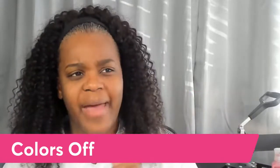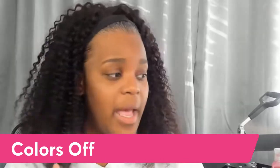That ICM, unless you are using an ICM or ICC profile, a color profile, is going to produce some very, very weird colors for you. No color adjustment, very, very weird colors, unless you have a profile in there. The automatic, it's not that bad. If you just leave it on that one, for some colors it comes out okay. Others, not so much. So you want to figure out what's going to be the best setting. For me, I find that Adobe RGB Gamma 1.8 is the best. May not be the best for everyone. You can do your own testing to figure that out. I did my testing, and Adobe RGB 1.8 is what works best for me in all of my settings. The last thing, I said 3, but it's actually 4.